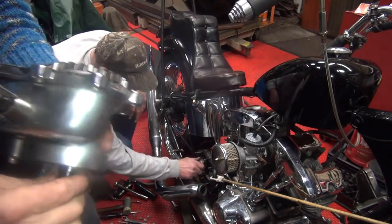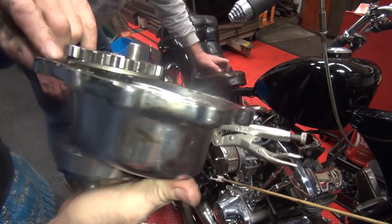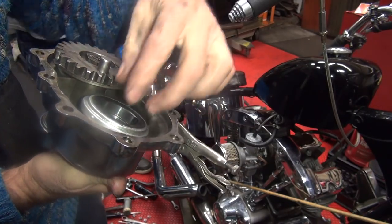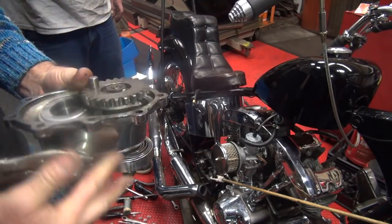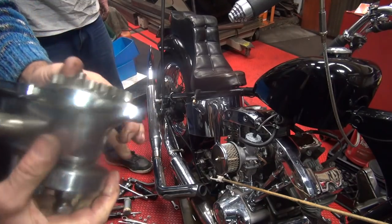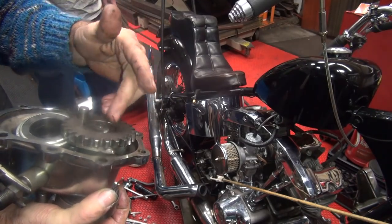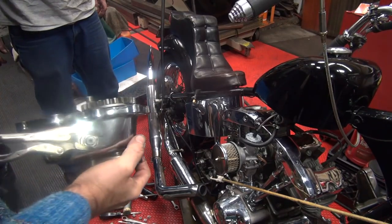So when you wind up this kicker gear, this ratchet stop right over here gets over here right where the throw-out bearing is, and that might be binding it, not letting it go on the kicker gear here where it has to go over. Might be what the problem was, I don't know. So I'm going to try to turn the kicker gear further. I did that by disengaging the ratchet so I can spin the gears around, and I probably had this all the way, you know, halfway through the kicker stroke. If you didn't have the spark plugs in there, you could have kicked the motor over and probably do it, but we'll work around that.